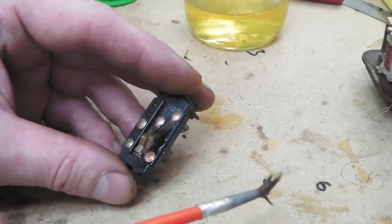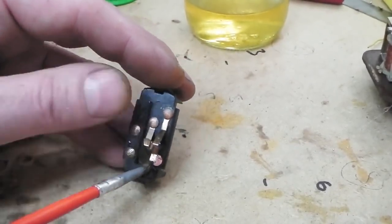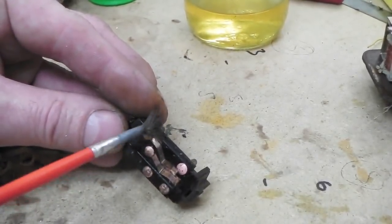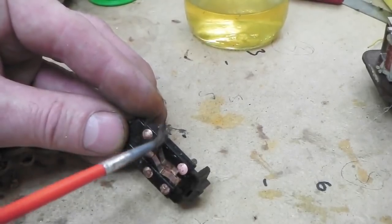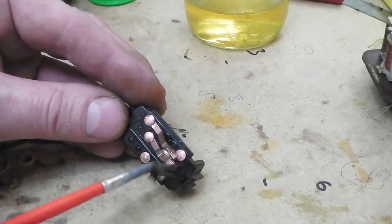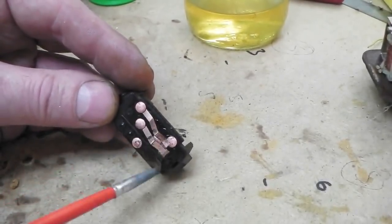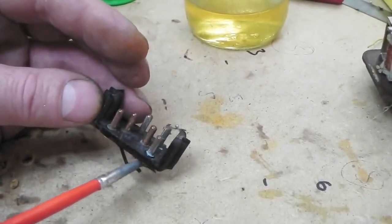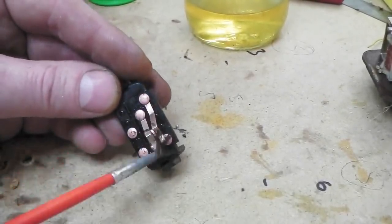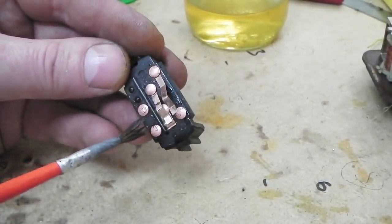Acid on here. Spider's all right, he's over there. Keep away from the acid, man. Look how the acid instantly cleans these copper connectors up. Wow, this is one of those wow moments. It takes zero effort to refurbish your very corroded headlamp switch, and this is prudent to do if you're doing a restore. I don't need to really do the tops of those contactor arms, but definitely need to do the faces and the pads. So we go into both contact faces. Okay, and look now, we're shinier than Shine McShine.